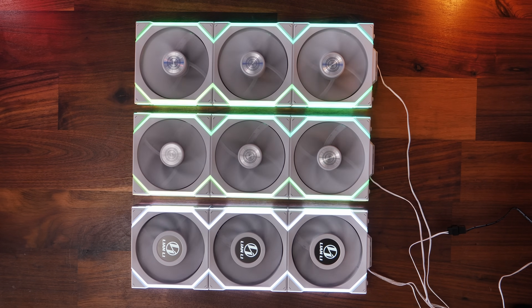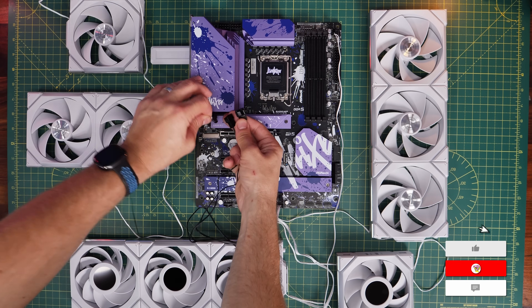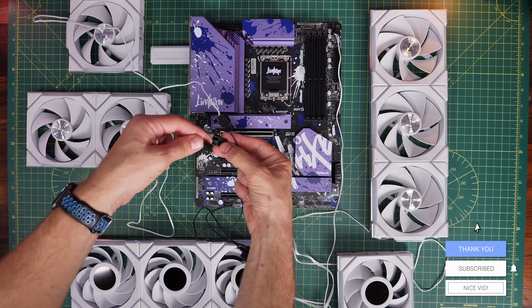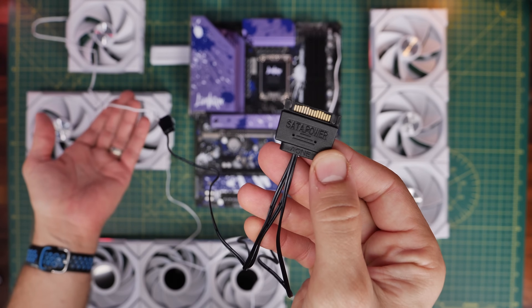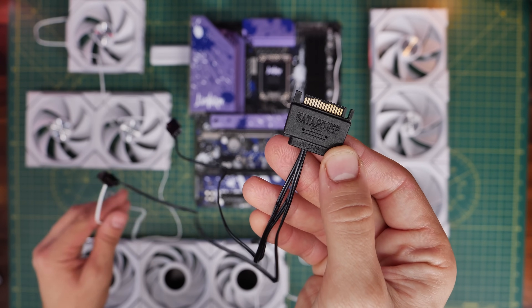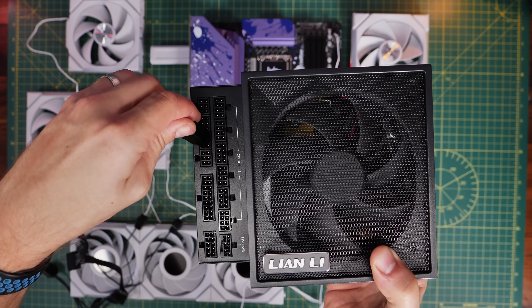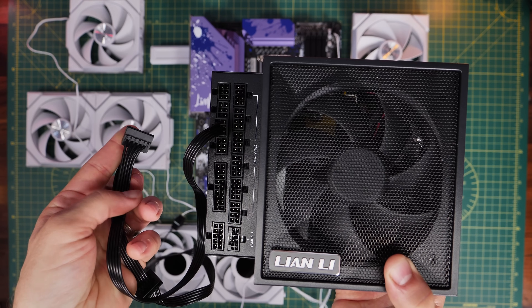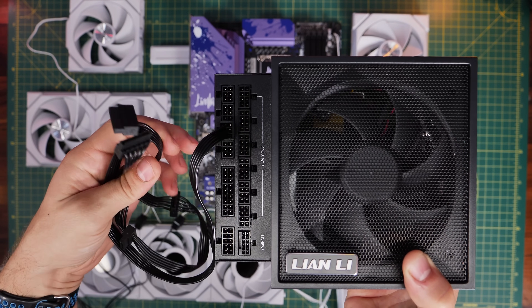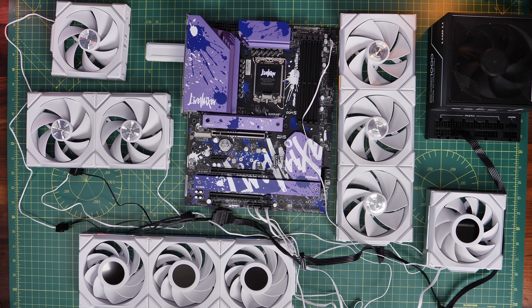You might also find that some fans flash white, which indicates they don't have enough power. As an alternative to the chassis fan header, you can use the included SATA cable instead. This takes the place of the chassis fan header cable — so instead of plugging into the motherboard, you plug it into this SATA cable and then into your power supply unit, getting power for the fans directly from the PSU. This can neaten things up, since you run the power cables to the rear and use the same flat SATA connectors used for hard drives and SSDs. The fans get more power than from the motherboard and it can make wiring neater overall.